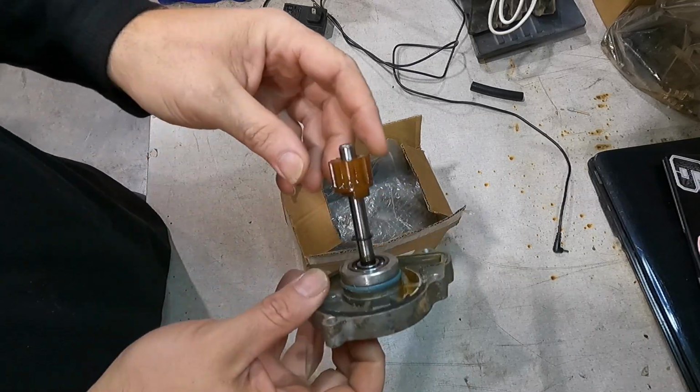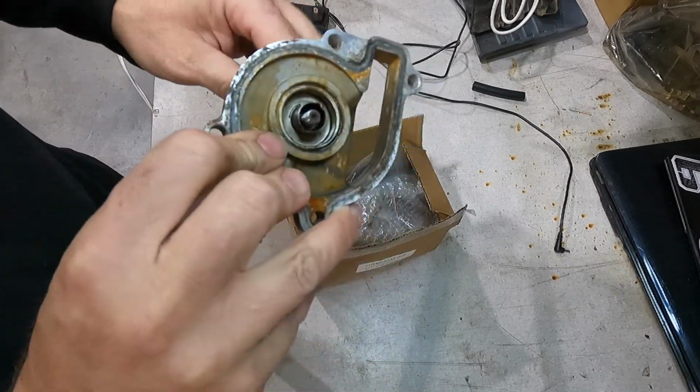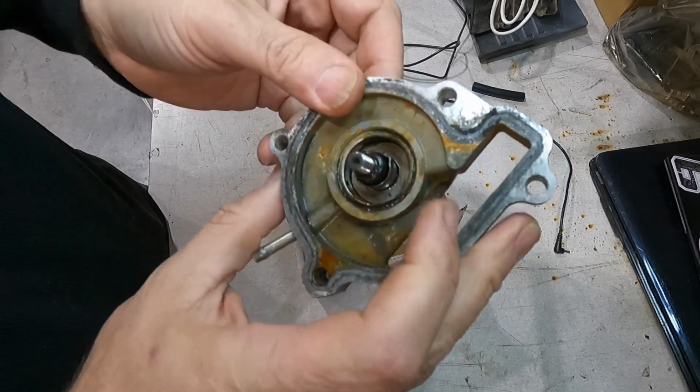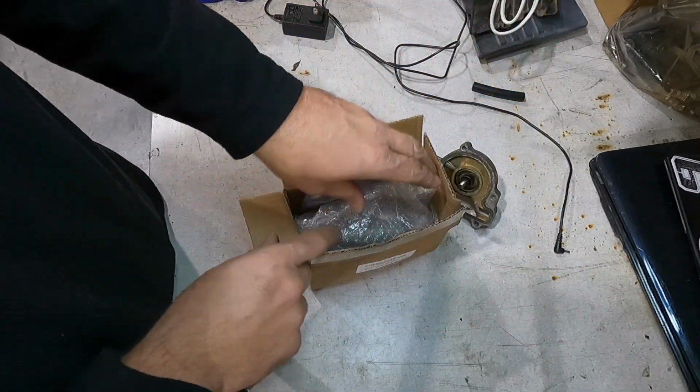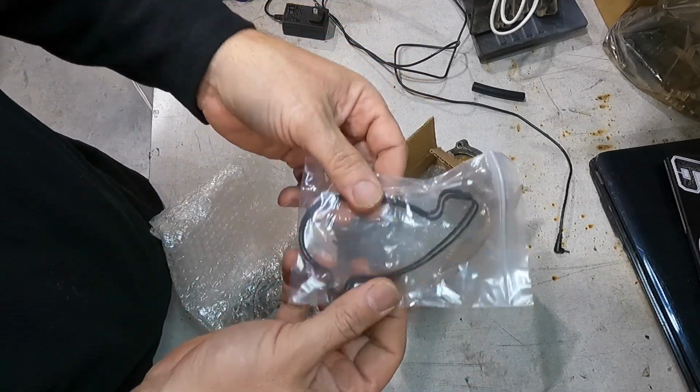I'll leave a link in the description. Here's the old one. Old one's pretty simple to pull apart. Just take that off, pull this off. As you guys can see, this one was severely corroded, damaged. It was leaking oil into the coolant. And so once again, comes with your 2 O-rings.